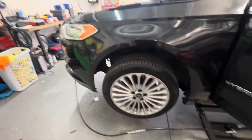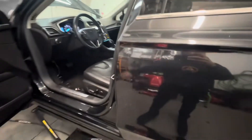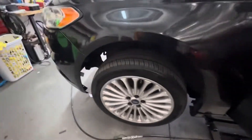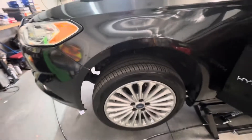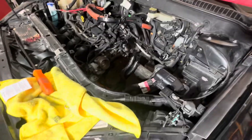The noise is coming from the bearing right there, and that bearing is a stator bearing. This is not the normal bearings that wear out within the transmission on the gear set — this is a different bearing in there. Follow us as we do this repair; I'll show you how to get it done because this is the only information I can find on it. The transmission has got to come out of the car.